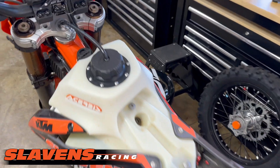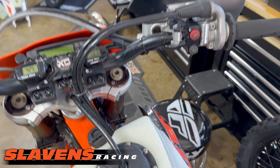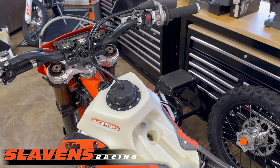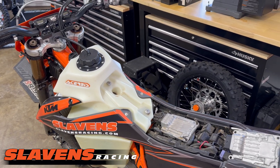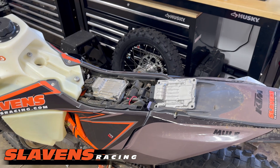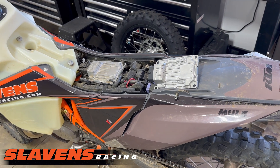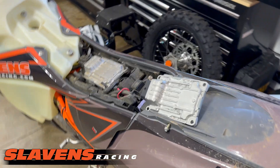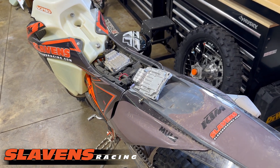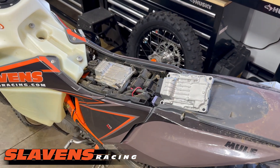These work with the map switches. This bike has the KTM brand power parts switch on here, and they also work with the Sick As handlebar switch so you can use both maps. We'll provide you with two different maps. If you live in Kansas or Missouri but go to Colorado in the summertime, we can load a low-elevation map and a high-elevation map. We're easy to work with — when you send it in, it doesn't stay in our office more than two days, maximum 48-hour turnaround, usually less.